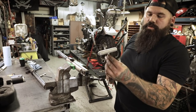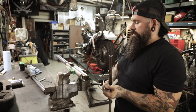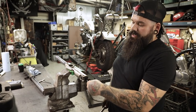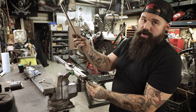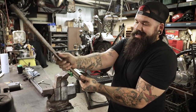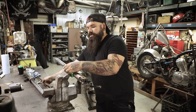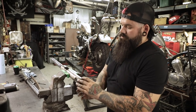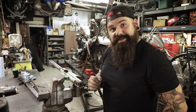If you don't have a nice T-handle wrench, you can use a regular Allen with a breaker bar — these bolts at the bottom of the fork are pretty hard to break loose. Put your Allen in there, get a breaker bar on the end, and crank it open. Today we'll use the T-handle wrench and break it free.